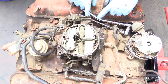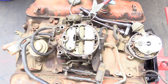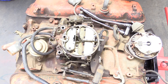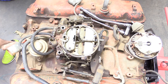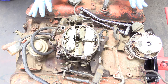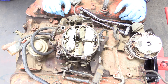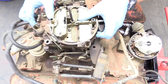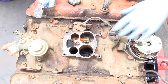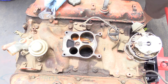There's another vacuum line on this side — I'm taking my own advice and just snipping it, because it's a vacuum line I'm never going to use again. Now if you were going to reuse everything and just do a cheapy cheap rebuild — there's no shame in that honestly — then you want to preserve those vacuum lines, carburetor, and stuff. But not me. So with the carburetor off, we now have the bolt access necessary to remove the intake manifold, which is a big step. But before we do that, we need to remove the distributor.